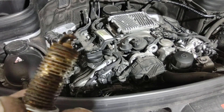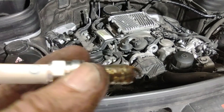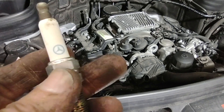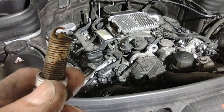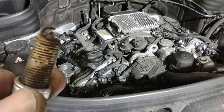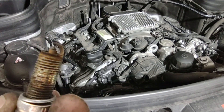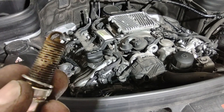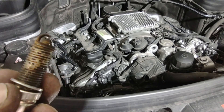Here's one of the typical plugs. They've burned open to about 0.035 to 0.036. Significantly, they've got the TriStar on them — that means these are probably the original plugs that have lasted for well over 150,000 miles. Folks, I don't recommend this. It really shouldn't go that long. Worst case, 100,000 miles, but I like to change them out between 50,000 and 75,000 because plugs are cheap, gas is expensive, and any little advantage you get is going to pay off in no time.